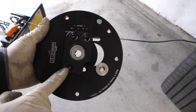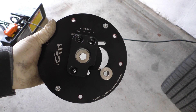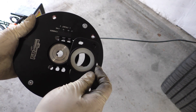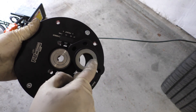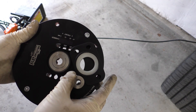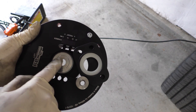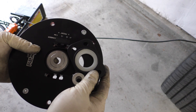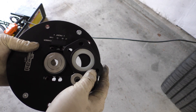I've taken off all the screws holding the camber plate together so you can see what the internals look like. If I take this top off you can see all this white here — this is the polyurethane damping material that goes between this silver plate or washer which captures the damper piston shaft.